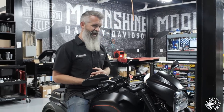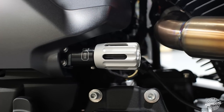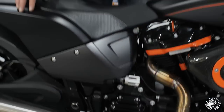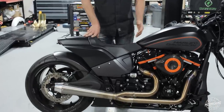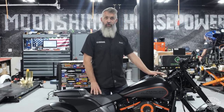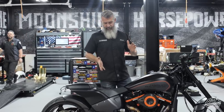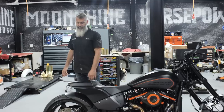It's going to be a plusher ride, full adjustability, a lot of tuning with that setup so you can dial in your motorcycle. On the rear we also went with Ohlins — right underneath my right leg here you have your adjuster. What this is doing is operating your compression for the HD 503 rear shock. It is a mono shock on the soft tail. You have the same exact settings on this rear shock as we have on the front forks: you're going to have a preload with collars on the shock to put preload onto the spring, and then you're also going to have rebound, which is on the bottom of the shock with a black collar. Fully tunable, adjustable suspension.